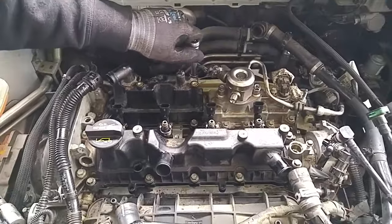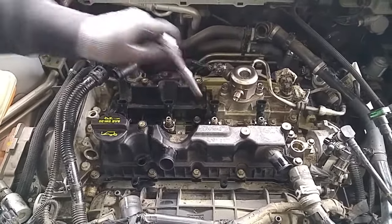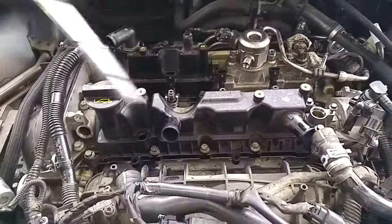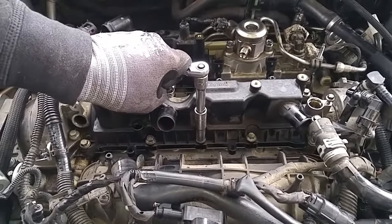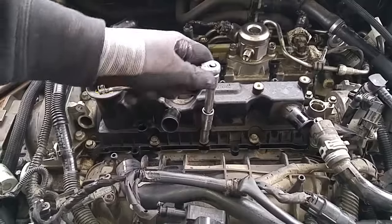If you have a 1/4-inch torque wrench and it's not calibrated properly, you could potentially shear the bolt off, which is why I do everything by hand for the little nuts and bolts. You're torquing it down, you're putting wrist pressure, so right when it stops, that's about it. See, it's not moving right here. That's right, a decent amount of torque.